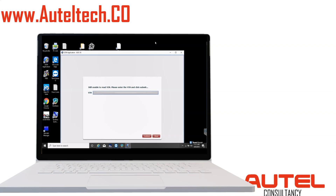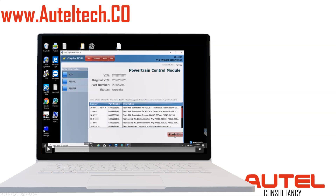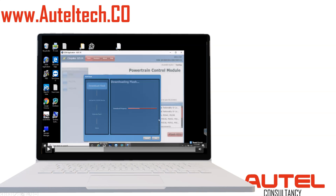Since it's a brand new PCM module, we have to pop in the VIN manually. After you put in the VIN, it takes us to the menu and we click Flash ECU and press OK. While it's programming, it's going to ask us to do some simple instructions — turn off the ignition and turn it back on — and then the process is successful.